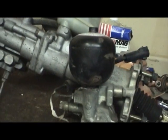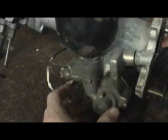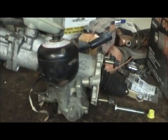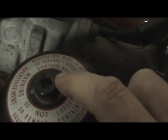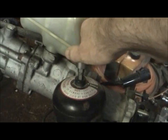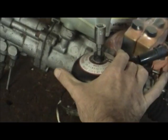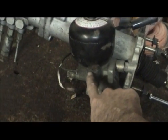But they are replaceable — a lot of people don't know that. You can buy remanufactured pump assemblies with the motor, the switch, the pump body, and the accumulator all together, but that's usually a lot of money. The way you would replace just the accumulator is the original one has an Allen fitting right here. You take a 5/16ths Allen socket and just pretty much unscrew it. They're usually not that hard to get off, but you might have to apply torque on here at the same time — you can get your hand down in this section and grab it as well. You don't want to damage the fitting that it screws into.